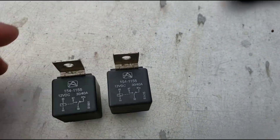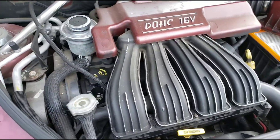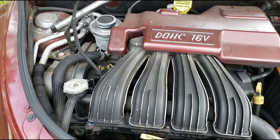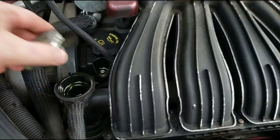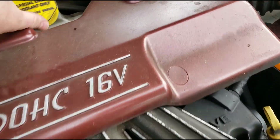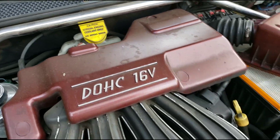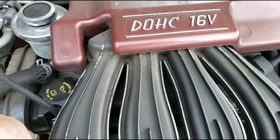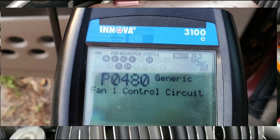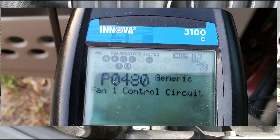There's two of these. So what happened is my car started to overheat randomly. I checked it for coolant — the coolant in here is full, and you never want to check that when it's hot. The fill point was also full. I got on my trusty engine check reader and it read a code saying it was a fan relay.